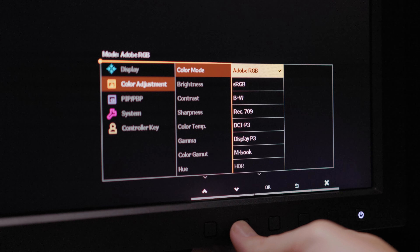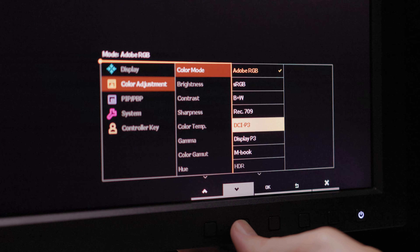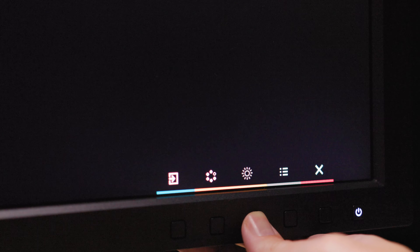When calibrating, you're not overriding the factory calibration modes — you're creating newly calibrated versions, so you can always switch back. One notable detail: display brightness is saved as part of the calibration, so the display automatically sets itself to the exact luminance you calibrated for. Unlike a normal display where you manually adjust brightness and hope you land in the right place, the BenQ automatically disables brightness control in the on-screen menu and hotkey puck when a custom calibrated mode is selected.